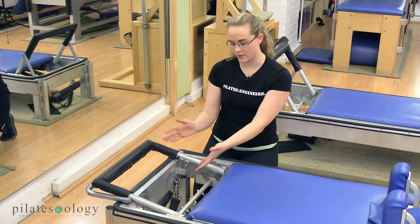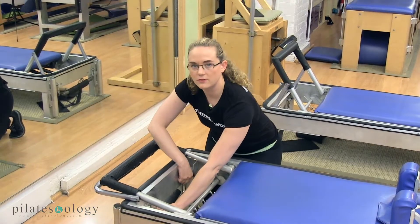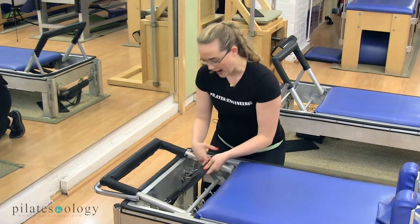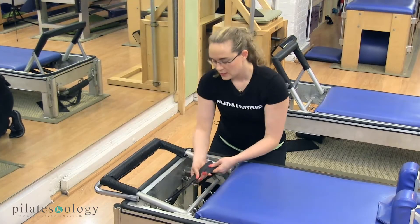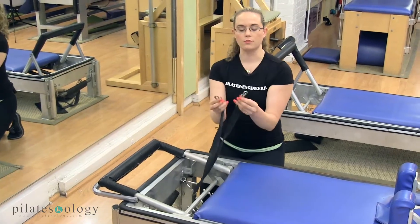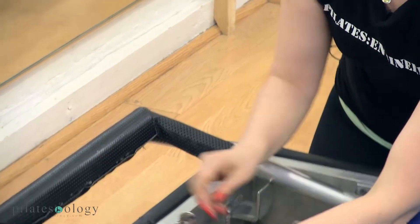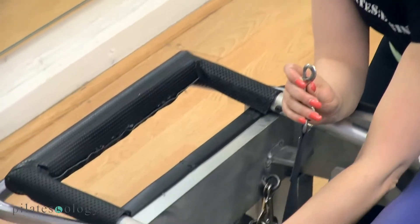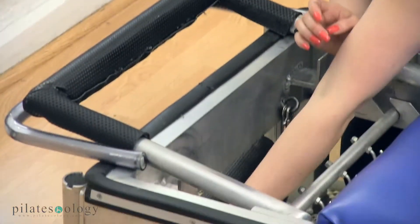The next thing over here is our safety straps. You want to make sure that the hooks that attach the safety straps are tight and straight, and that the safety straps are intact with very little fraying, and that the attachment hooks are not worn or broken in any way. You also want to make sure that on each side they're facing opposite directions — so this hook will go in like this, and then this hook will go out like that on both sides.